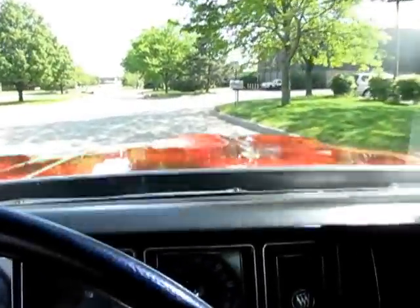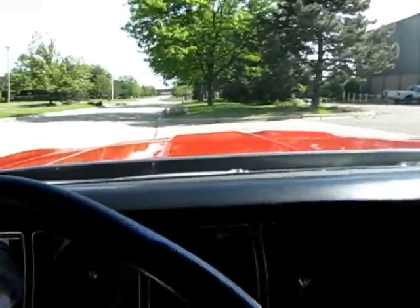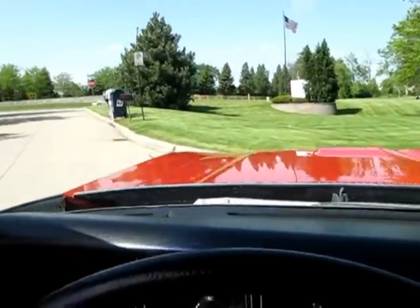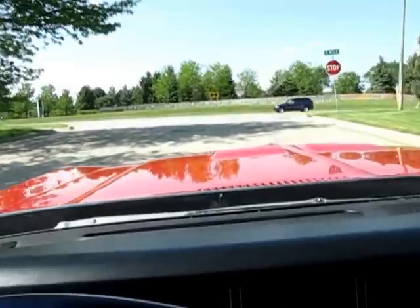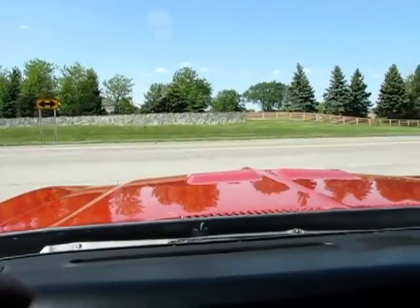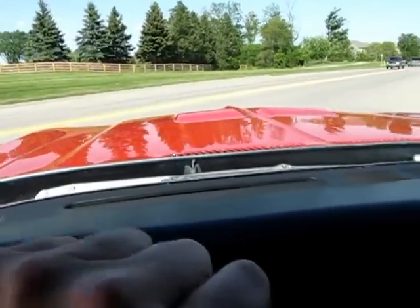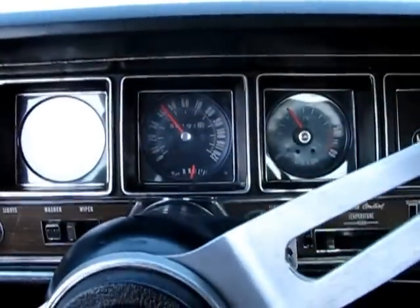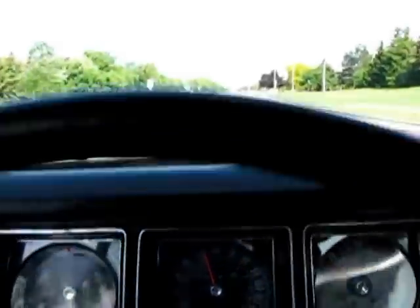Don't hear any unusual whine coming from the rear end. It's got a correct 10-bolt rear end with the boxed lower control arms. I was able to get a casting date off the pumpkin: L79, I think, or L11.9, so a late '69 cast pumpkin. You know what the build date of the car is? Should do 0 to 50 in a couple seconds. That's 55 miles an hour.